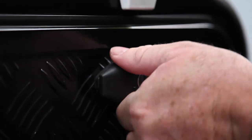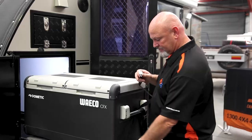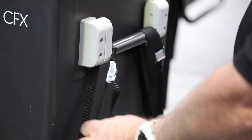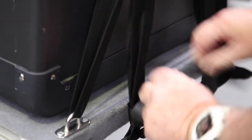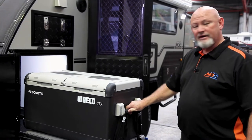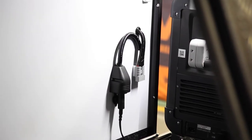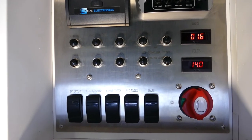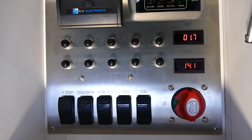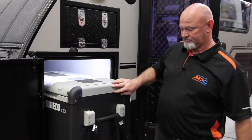On your XT12 HR, the passenger side or left-hand side of the van at the front — the first compartment is your fridge slide. Blue tab down, pull your fridge out. For securing your fridge, there's a D-shackle at the front and a D-shackle at the back so you can strap it down. You can go through the handle, pop that through, shorten it — basically that's just to tie it off so you don't have any excess. Once all your tie-down points are done, front and back, it's nice and secure for when you're going along the road. On your fridge slide you have a 12-volt socket and an Anderson plug socket — plug it in and you're good. Your kill switch and main switch must be turned on, and also your fridge switch on there — otherwise it doesn't complete the circuit so you won't get power to your fridge and you will have hot beer.